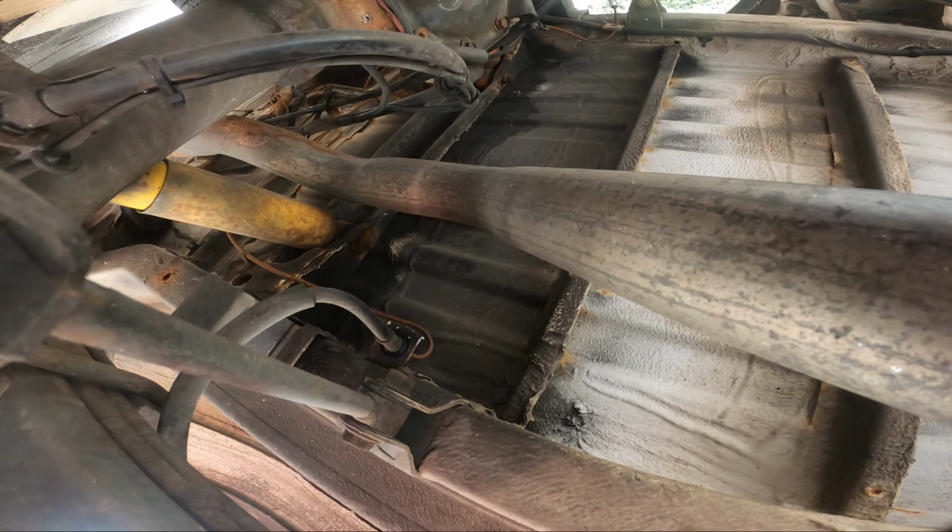Nice. Looks like there's nothing new. I gave it 4 or 5 pumps and couldn't push it all the way to the floor anymore, and I haven't even bled them out, so that's a good sign. Granted, once I fire it up and have vacuum to the booster, things will change. I'll get more pressure. Hopefully it won't start leaking.